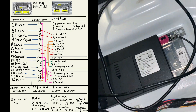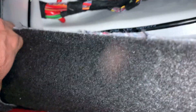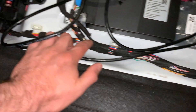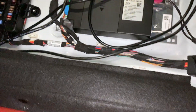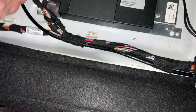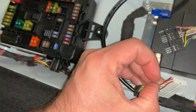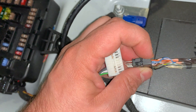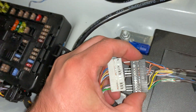We left a really long pigtail here for the one that comes from the MBT — we're going to pass it through here and reunite the cable with this pigtail, then use our adapter that we just created. Off camera I taped here and here, and now we're going to unplug this. Power goes here, ground, and same thing here — we have our power and ground so we can check those and confirm our pins match exactly where they're supposed to connect.